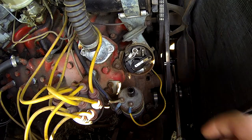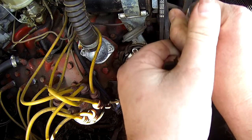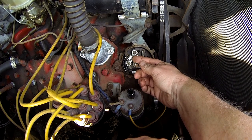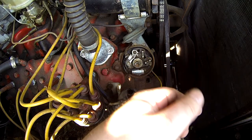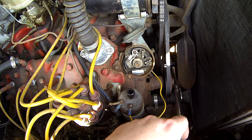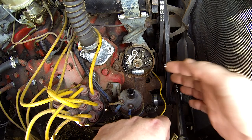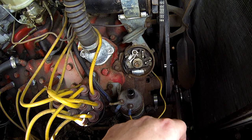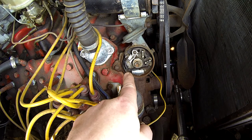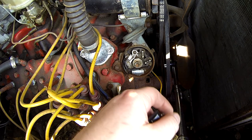You can see the lobes on the cam right there — I'll want to get the lobe up on the ramp and measure the fully open point gap distance. I also have a fairly large collection of engine analysis tools including timing lights and a dwell meter, which actually helps set the points even more accurately — kind of like setting the timing a little bit. I'll get it wide open and measure the gap; I haven't looked up the spec in a while, probably 6 thou or 10 thou or something like that.